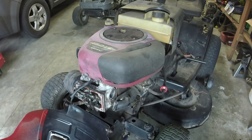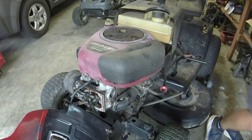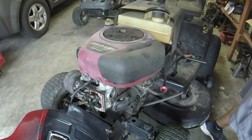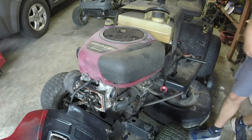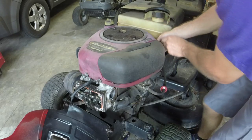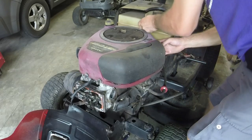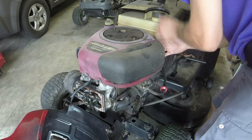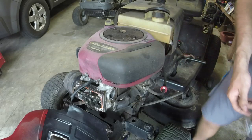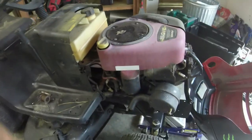And then on the back side, I just take my 3/8 inch ratchet sockets. Clean it up as I go here. And there's just two bolts in the back we're gonna take off. Again, these you don't have to take off all the way. Some others you do. Caught y'all on, but saved ya. And here's the other side.